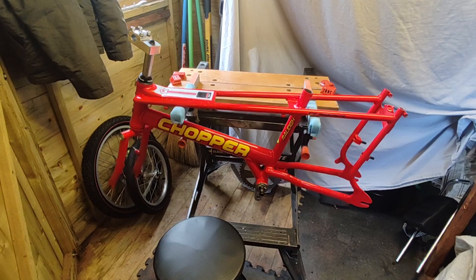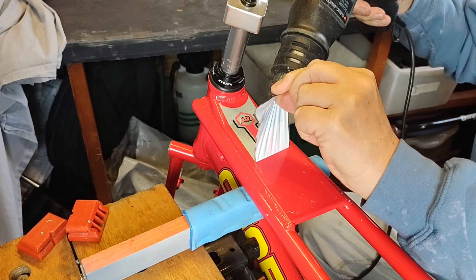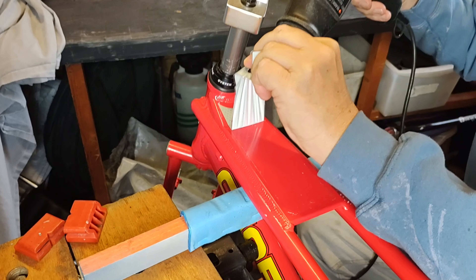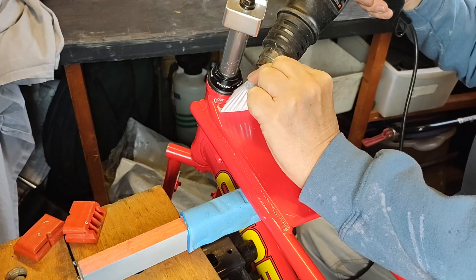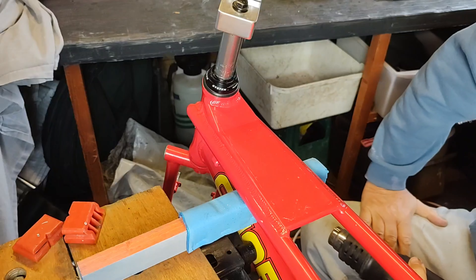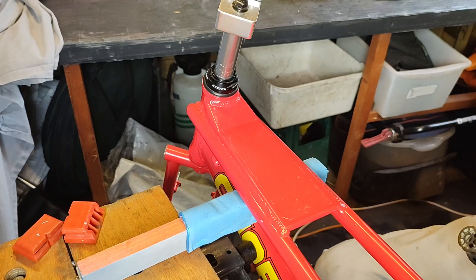As you can see the bike's stripped down to the frame, it's now mounted on a stand and it's ready for the next phase of work. I find applying a bit of heat to the decal softens the glue and the decal itself, making it easy to get off in one piece rather than being chipped off in lots of little pieces.